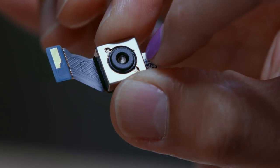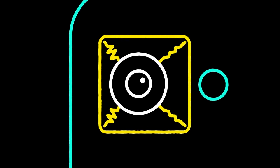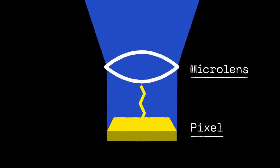This year, there's also optical image stabilization. There is an actual physical piece wrapped around the lenses, which has motors on it, and it can align the lens in a number of dimensions. Focusing moves the lenses in and out, while optical image stabilization moves them up, down, left, and right. You can see it moving around as it compensates for whatever your hand is doing. Then, just a millimeter behind the lenses is the sensor — the equivalent of film for a digital camera. It's covered with light-sensitive photo sites, aka pixels, which capture the light and convert it into an electric signal.